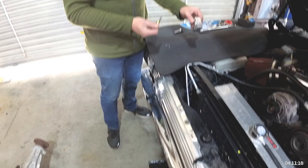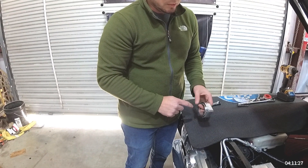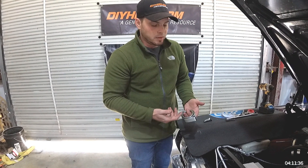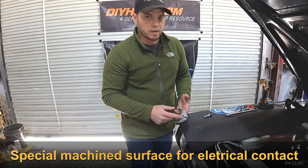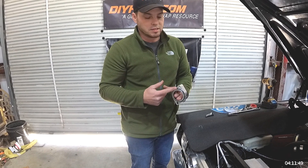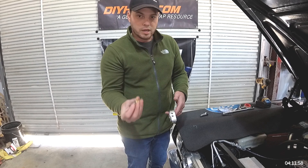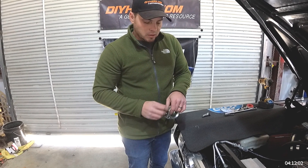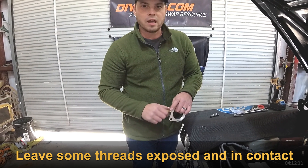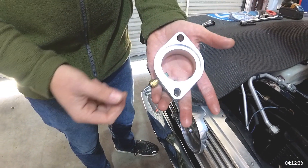Some people would like to put their sensors in on the engine, some off — I prefer off. One thing to note: these surfaces around the O-Ring are machined. While the entire body is anodized aluminum, this area is not anodized, because anodization prohibits electrical conductivity and your sensors won't read correctly. So if you do paint this to match your engine, make sure you do not paint this surface. Same thing goes with the tapped threads — when you thread in your sensor, put some Teflon tape or sealant on, but make sure a portion of your threads are not taped so you have a good conductive path. With the sensor in, you can see it places the tip of the sensor in the fluid stream — exactly what you want for this type of setup.